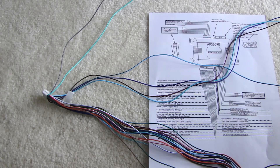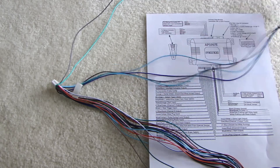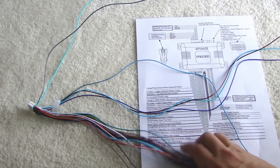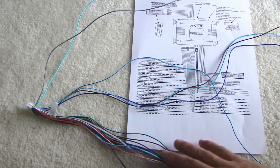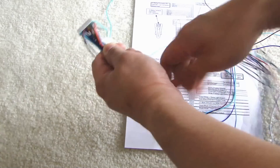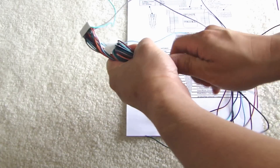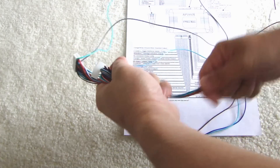Here is the 26-pin wiring harness. As you can see these are the smaller gauge wires and I've pulled out all the wires I'll need. Some of these are your channel output — I'll be using it to control the sliding door. These remaining wires at the bottom, a lot of these are going to be provided by the bypass module via the data connection, so I don't need to hook these up. Same as the other harness, I don't like to cut all these off in case you need them later on. What I'll do is bundle these up to make it nice and tidy and then put a couple of tie wraps on it.